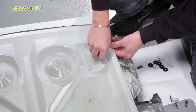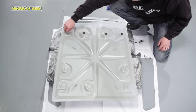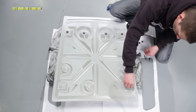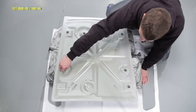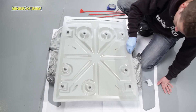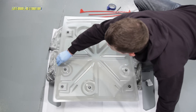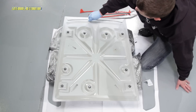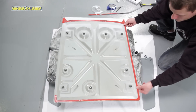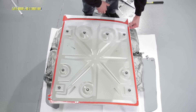With the hood scoop laying upside down, remove the stud protectors from the underside of the hood scoop. Remove the backing from eight of the circular isolators and install them around the eight studs. Remove the backing from the ninth isolator and stretch it around the locating dowel. Wipe down the outer surfaces that will accept the double-sided tape with rubbing alcohol and allow to dry. Apply the 3M adhesion promoter to the clean surfaces and let it dry for at least a minute, then apply the double-sided tape with the red film facing up.